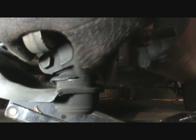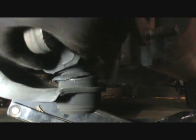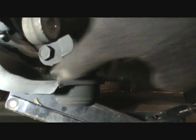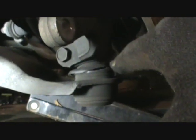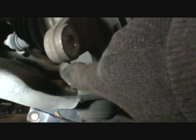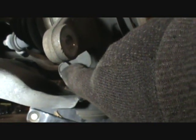The other one was pretty tight still. So at the very least, I'm going to just repair this as best as possible and repack it with grease. Once I get back together, I'm going to take some urethane rubber sealer and go all the way around it as best possible and let it cure up, to prolong its life a little bit longer. So anyway, grab your 14 socket and 14 wrench and get started and pull this bolt out, and we'll pick up once we get that apart.